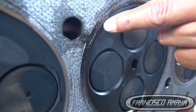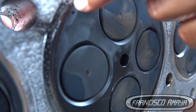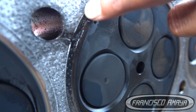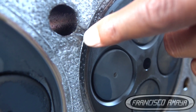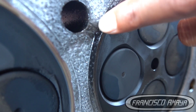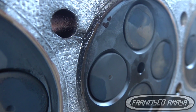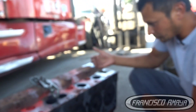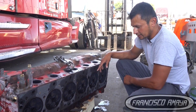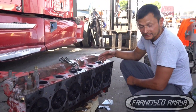This one is broken right here. That is broken, and the compression was leaking from here and through here. You can see the head gasket being broken — that was the whole reason why this engine was having that malfunction. The cylinder head gasket was broken, and this is not something that is easy to fix.